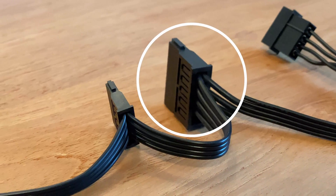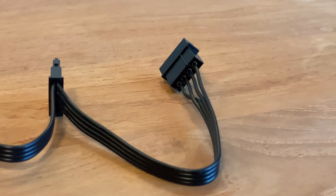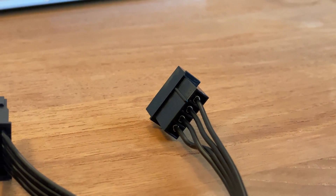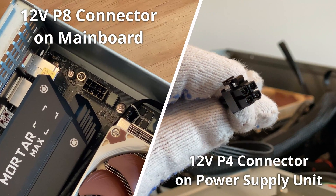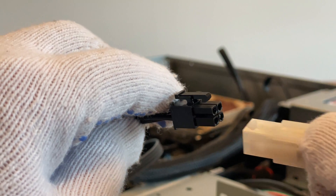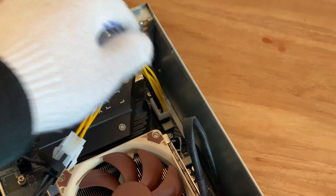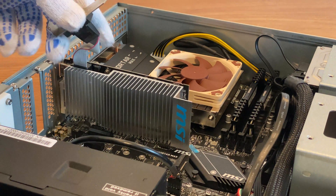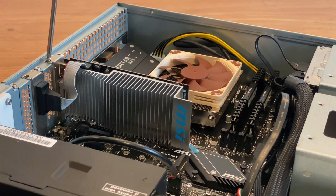I know what they say about the dangers of using Molex-to-SATA adapters, but since the ones I use don't have cables molded into the adapters themselves they should be fine. Find the link to another video in the description to learn more about the dangerous kind of Molex-to-SATA adapters. The mainboard has an 8-pin CPU power connector while the power supply only has a 4-pin connector. To still be able to power the CPU I am using a splitter that splits the 2x2 pins of the PSU into the 2x4 pins needed by the mainboard. As the CPU I selected is not very power hungry this works fine; however, when using a high-end CPU one may need to select a different PSU. Since my CPU doesn't come with integrated graphics I am using an old NVIDIA GeForce 210 to adjust BIOS settings and for the Unraid installation.